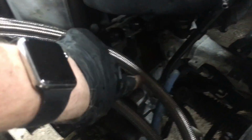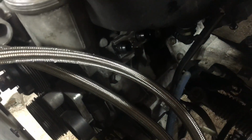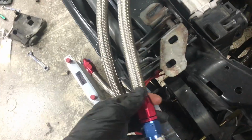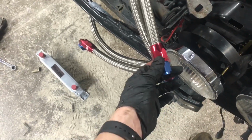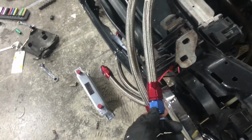I've got to trim these hoses down again and put these 45-degree fittings on there. A little bit better fit. These are all reusable, super duper nice. This stainless hose is a pain to deal with, though. You're gonna end up poking yourself with stainless steel wire and bleeding quite a bit, but stuff's up for a lot of pressure and holds up really well. And it looks really cool. So if you want to look like you have an official build, get a whole bunch of AN.